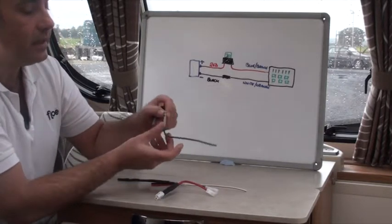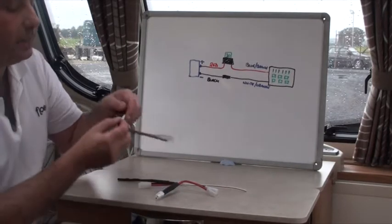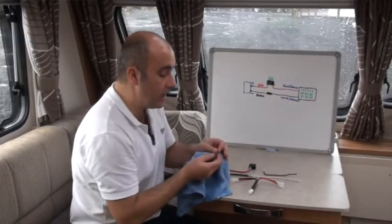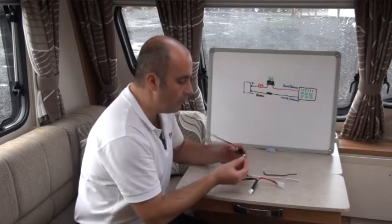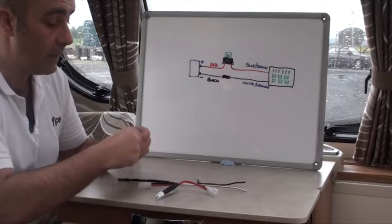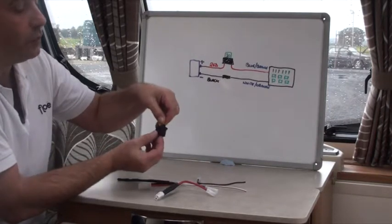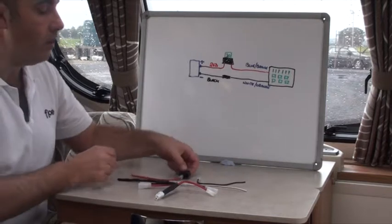Now let me show you how to separate the fuse holder connection. When you try to pull those little silver clips out, it can be quite difficult and sharp on your fingers — but you haven't broken it, it's designed to happen. Use a little piece of cloth to pull it out. You don't need pliers. Simply slip it back up inside and it fits over the prong. To show you from the other side: take the fuse out and you'll see the two little teeth for the fuse to sit in. Replace the fuse and put the cover back on.